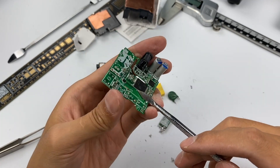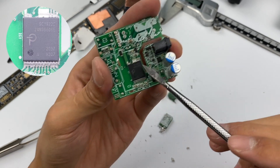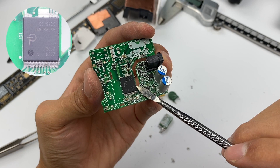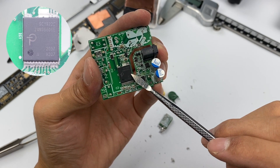The front of the PCB features the master control chip of the switching power supply, marked SC1922C. This chip is customized by Samsung from Power Integrations and integrates a switching transistor, primary PWM controller, synchronous rectifier controller, and more.